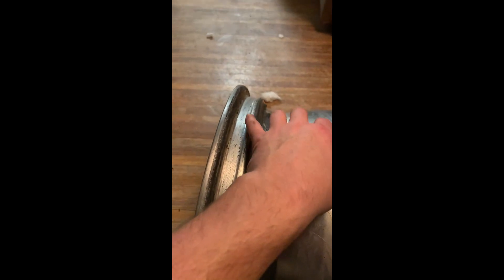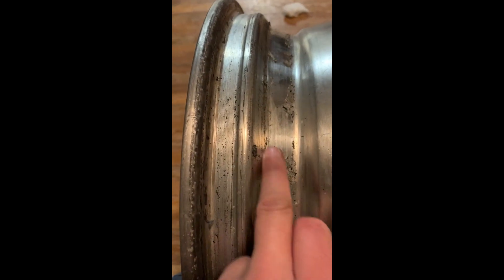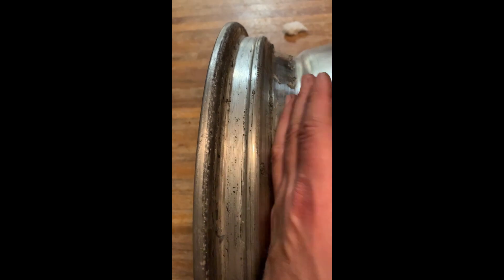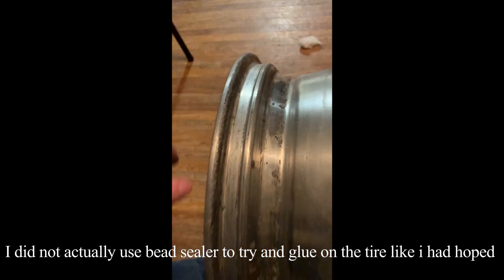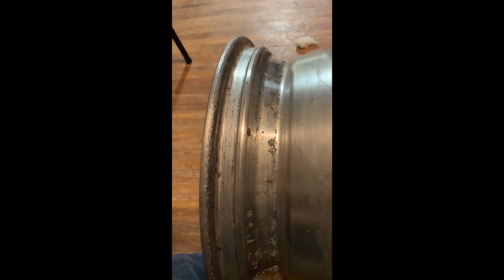So I think my next idea: I'm going to wrap the wheels like I normally do, and then I will probably do another two wraps. I will take the edge of the tape right to the edge of the wheel and do two wraps. One, it helps hold this tape in place more. It'll keep it from pushing off because there really isn't much surface here for the tape to hold — you can see it goes here and then it drops off. So it'll help hold the tape in place there, inside and outside. And then when I get the tires mounted, I will use bead sealer on the inside and outside beads, hopefully trying to get the tire to be glued in place.